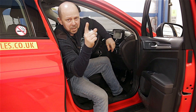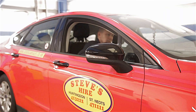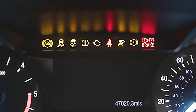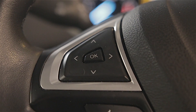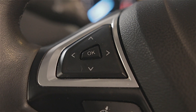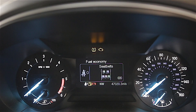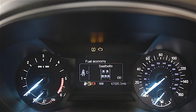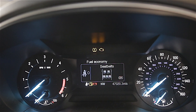Let's go. So the first thing you need to do: make sure all your doors are closed and switch your ignition on. If any warning messages flash up on your display, you need to press the OK button to clear each message. If you have this screen now displayed, press the OK button once again on the left-hand side of your steering wheel.